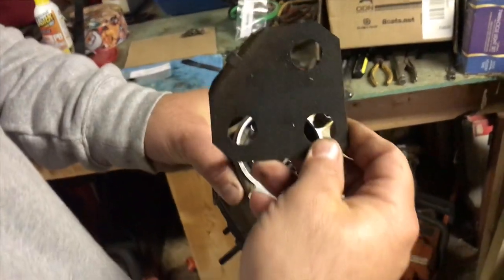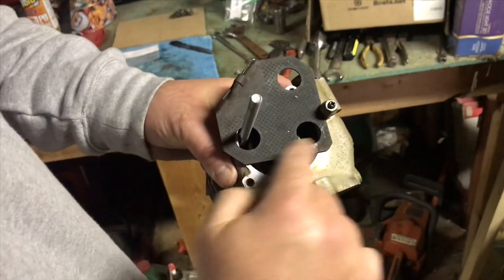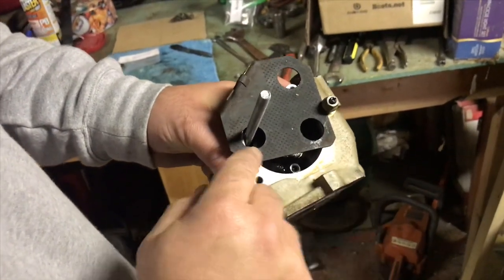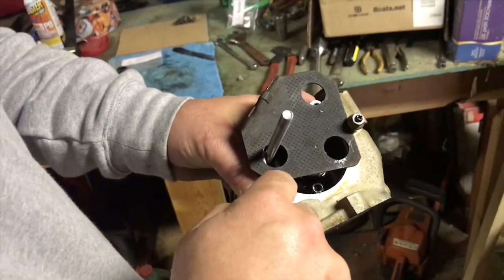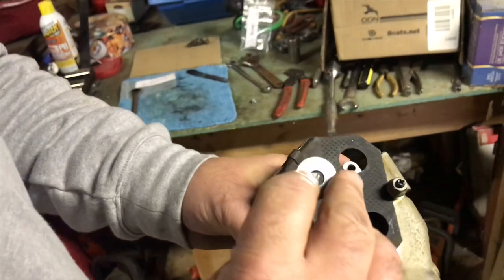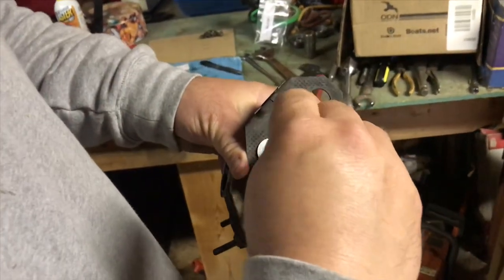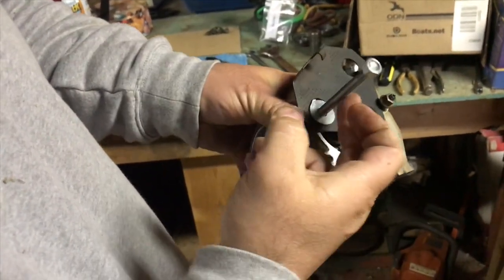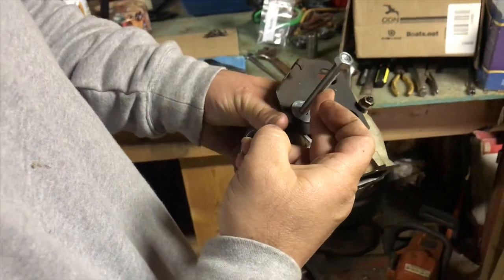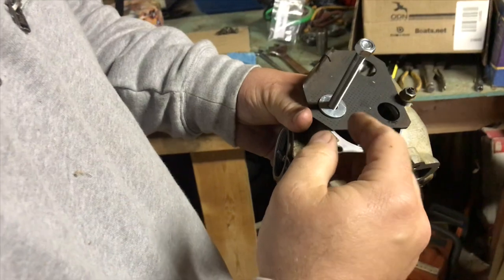And I found this plate that'll sit over it like that and go across the whole span. I tried a washer at first, but the washer just tried to dip down inside this bore. So I put that plate on there, then I put this washer on there, and then the nut. Just tighten this down with a pair of pliers. Doesn't have to be stupid tight, but there's only a few threads in that rocker arm shaft to hold on to.